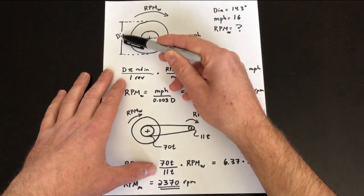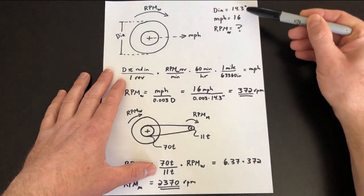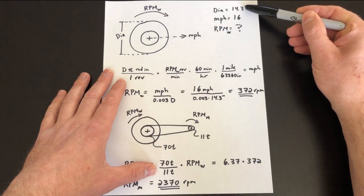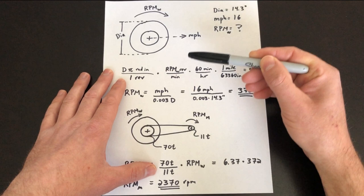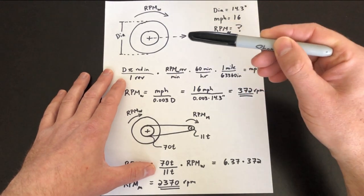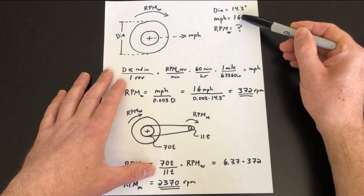At full extension, that's the maximum the throttle will go — it allows the motor to spin as fast as it can. When this bike was brand new out of the box it wasn't adjusted to full throttle, and I don't want it to be — I'd like to keep this motor for a long time. I determined it was probably cutting out around 2,500 to 2,800 RPM, and we can validate that mathematically. In order to figure out how fast the engine is spinning at a given speed, we first have to find out how fast the rear wheel is spinning. To solve for wheel RPM we need the diameter — 14.3 inches — and the speed, which I measured with a phone app at 16 miles per hour.